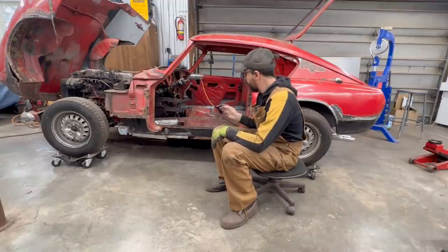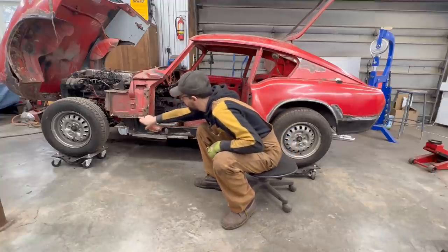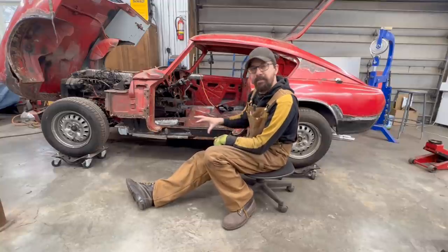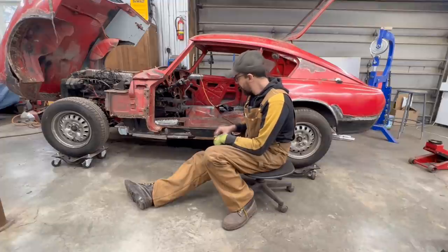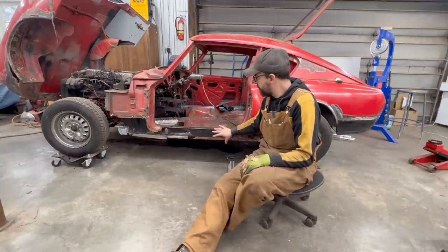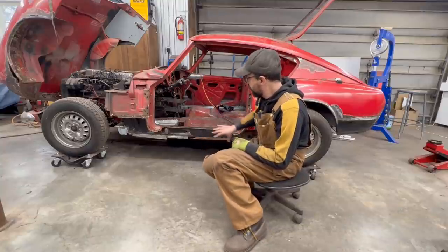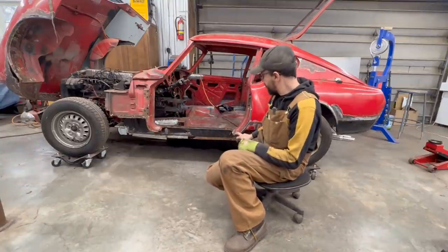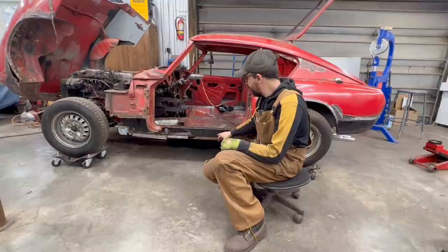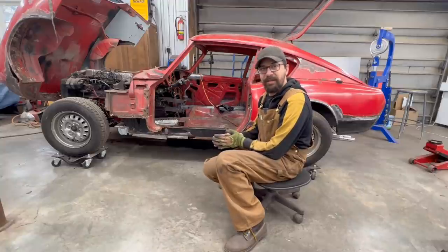One thing I noticed: it is really curved in the middle, so this is going to have to be pushed up at the end to make sure the line is straight. This is the part that matches our flange here, so it needs to be nice and straight. Anyway, that gives us the possibility to continue working on this mess right here. So what I'm going to do is remove the transition piece, clean up a little bit more, fit the seal, install the door, make sure the door gaps are good, and then finish the flange of the floor. That's our starting point.